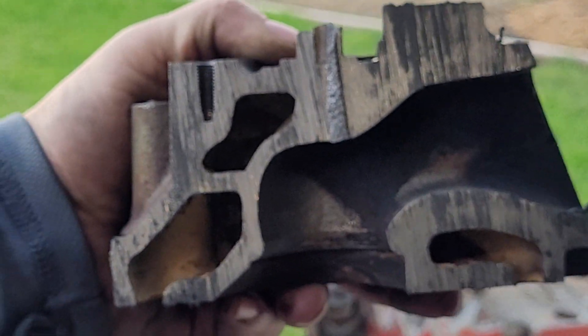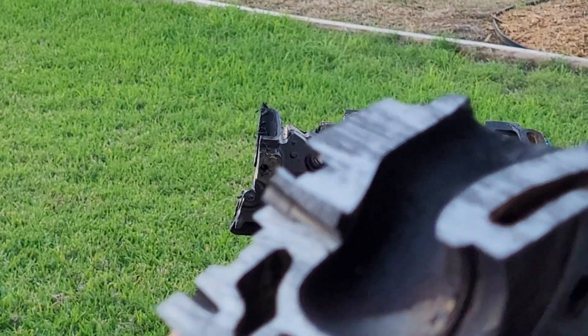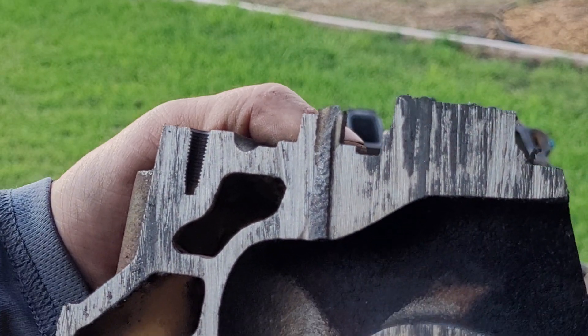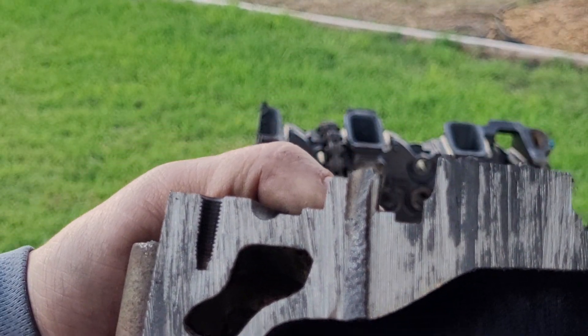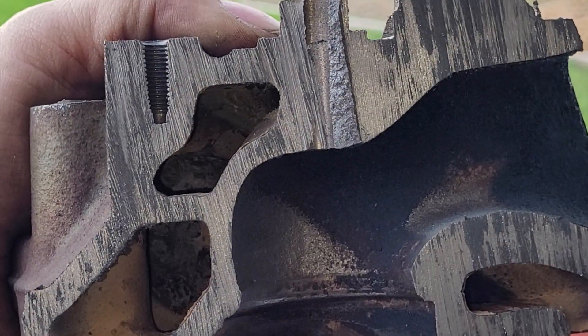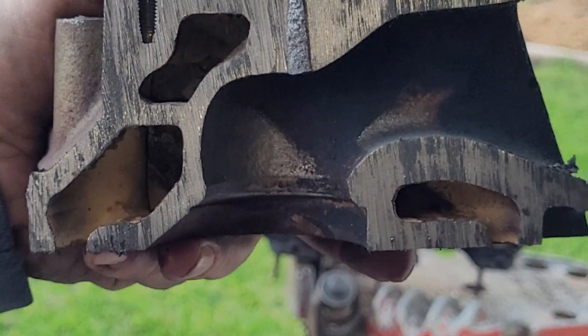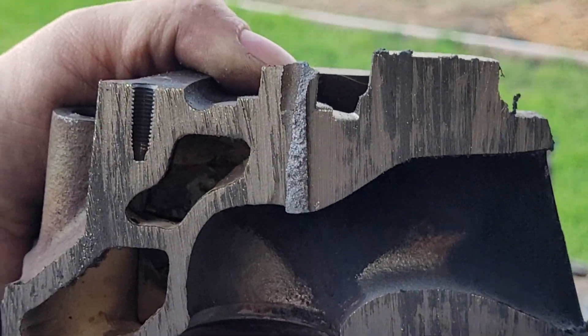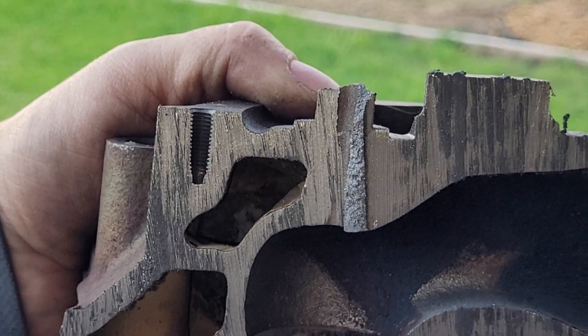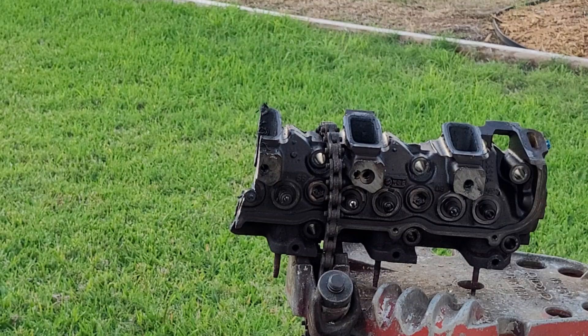A little trouble seeing what's on the camera, but you get the idea. Yeah, I didn't line it up perfect, but that's a pretty good cutaway. They gave us a ton of metal on the short side — wow. Notice how flat that port is. It has a flat, flat valve angle, which of course means the air has to turn even harder. I'm going to do the exact same thing on the exhaust.